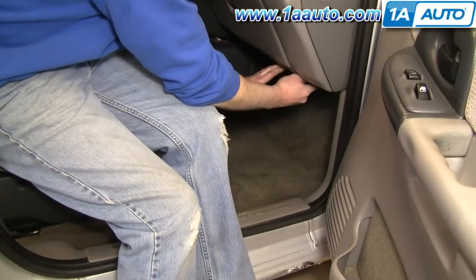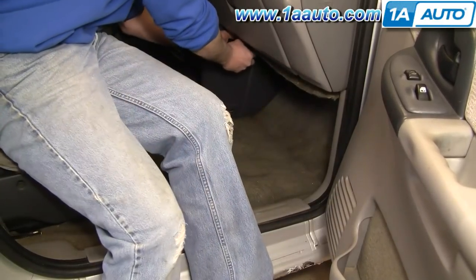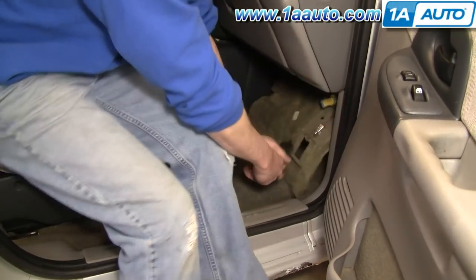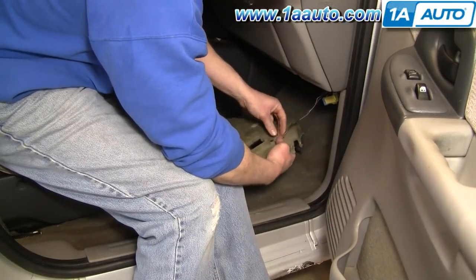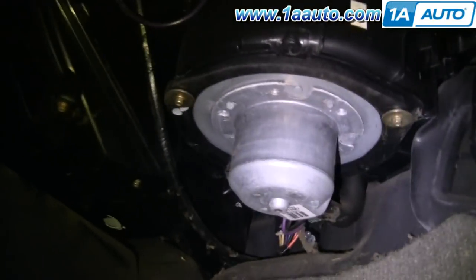You want to start at the passenger's side underneath and pull out three pins — here, here, and here. Try to grab as close to the pins as you can and push down. Sometimes the pin won't come out, so just use a pair of pliers to remove it. You can just let this hang down, feed your wire through, push it down, and bring it through. And you can see your blower right there.